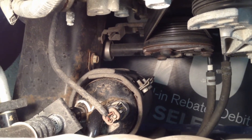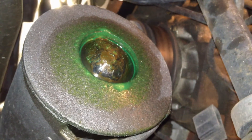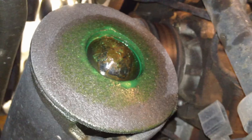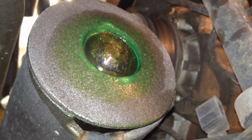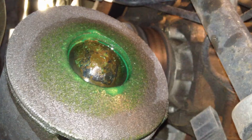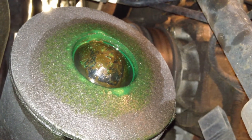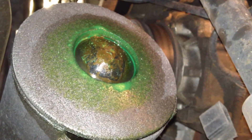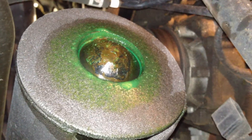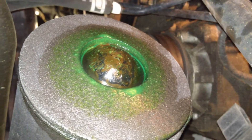When doing a quick visual around your engine compartment, if you don't see any oil, dye, or otherwise up top, you need to really look below. Coming down below, you can definitely see on the bottom side of the accumulator that there is a leak. These will get wet — the whole foam ring will get wet with water — but don't count that as a leak. What you're looking for is the actual green dye from the AC system coming out with the oil; that's where your refrigerant leak is.